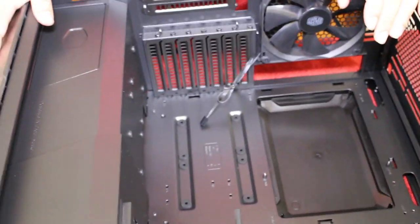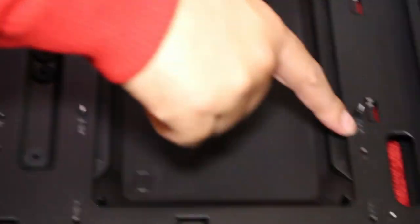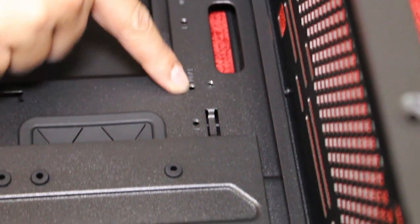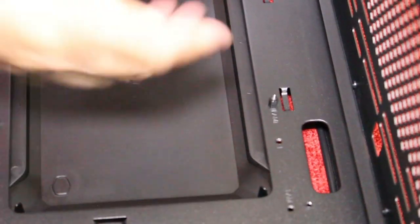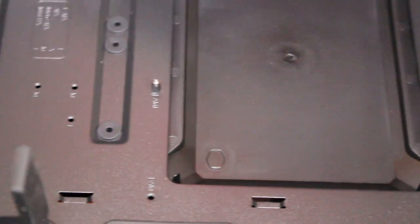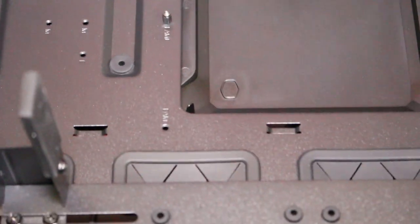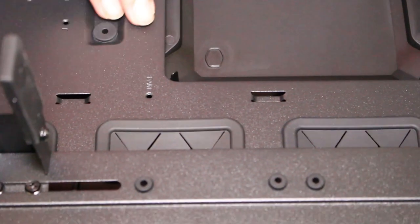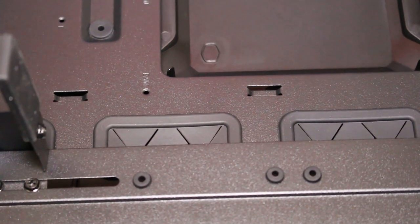So we need the standoff screws for the motherboard. All the ones that have an A here need to have a screw in there to hold the case. So they just stand off, so they keep it away from the case, and that's what the motherboard hooks into. But by the looks of it, there's some missing, because there's only one, two. So they've only got two in here. There should be a bag